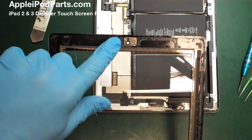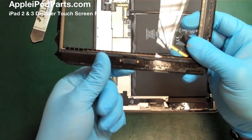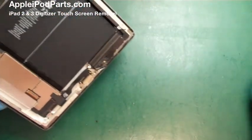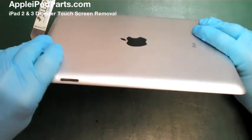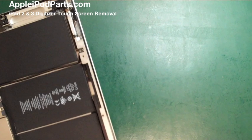What we need to salvage from the old screen is the camera bracket and the home button with its bracket — those are essential for the rebuild. Put the screen back in the oven for 10-15 minutes at around 50-60 degrees just to loosen them up, as they're only held in by adhesive, and replace the adhesive on those as well. Gently tap and shake the iPad to get rid of glass, and use the mini hoover and an airline to make sure every single bit of glass and old adhesive has gone — there's no good having old adhesive on there because it won't stick down properly.